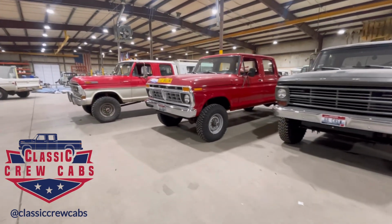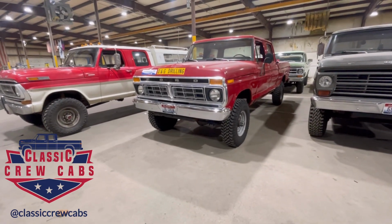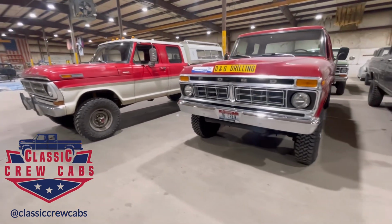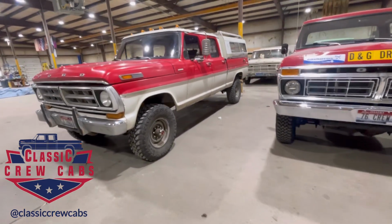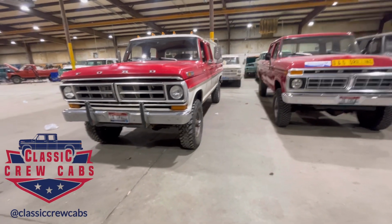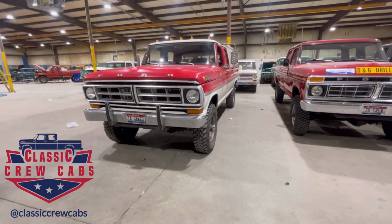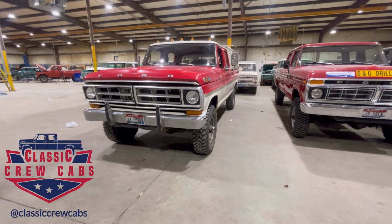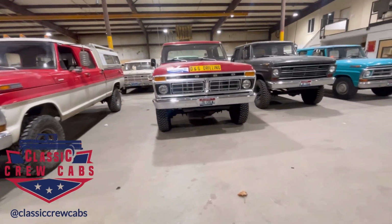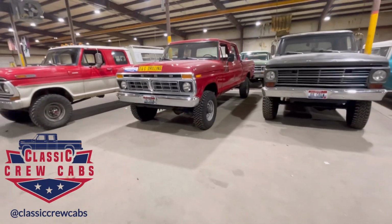The 76, right here, crew cab, we have the factory power assist with the control mechanism and the power assist ram. And here in my daily driver 71, I've got the 2-wheel drive box from like late 60s to basically late 70s. It's a 3-bolt box that hooks onto the frame with an adapter plate, so you don't have to cut the frame.